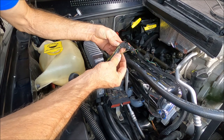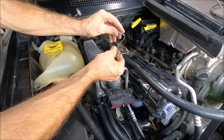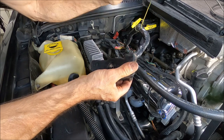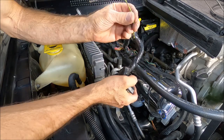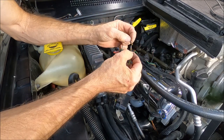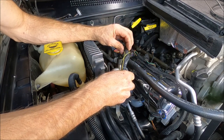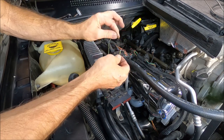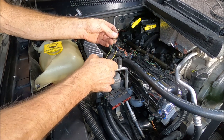There's one of them, and here's the other wire — this is the original wire that went into this harness and plugged into the connector. If I wanted to reconnect it, all I'd have to do is plug that in, tape it back into the harness, and I'm good to go. But the way I have it is disconnected, and that way your torque management is not working — it's deleted.